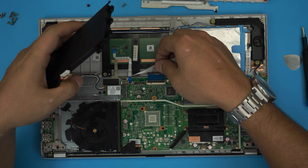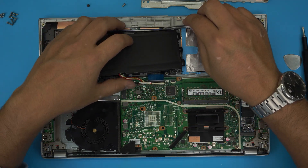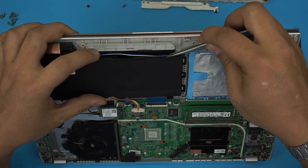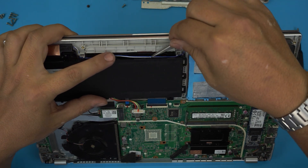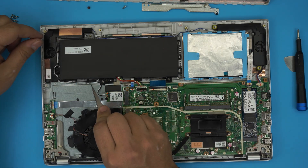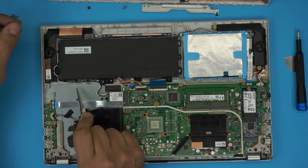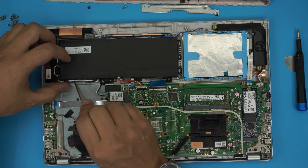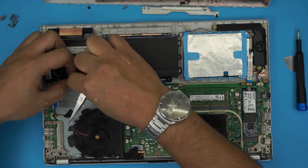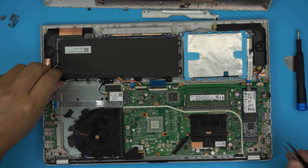Once you have the new battery, go ahead and put it in. You don't need to route the cable underneath the jack — just slide the battery back in and close the lid. Route the speaker cable up and down in its path. If you want to re-route the Wi-Fi cable you can, or just leave it — there's empty space there. If you want to be thorough, do the zigzag routing and run the Wi-Fi cable along beside the battery.